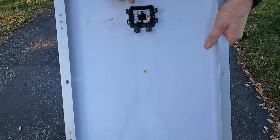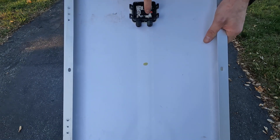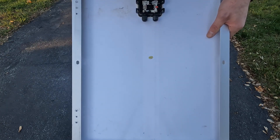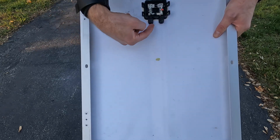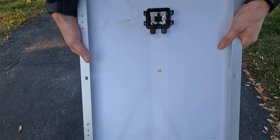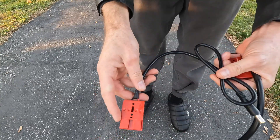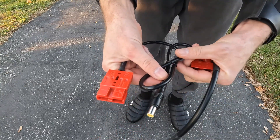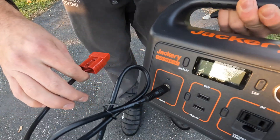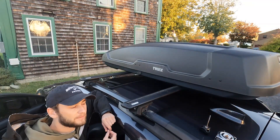This is a close-up of a few of the components. This is the backside of one of the panels — you can see where I snipped the wires. I'll use a soldering gun to collect this extra solder, remove these wires, and reroute them to have one wire coming in from the other panel and the other wire going to the adapter. This is the adapter — these are called SB50 clips, and it's an SB50 to an 8mm connector. This fits into my Jackery as the solar input.